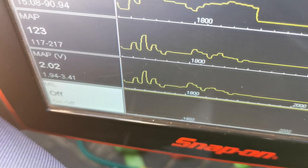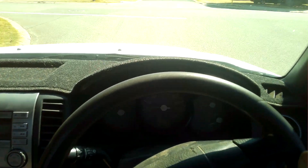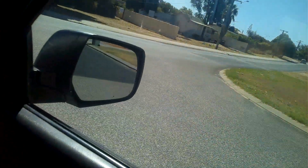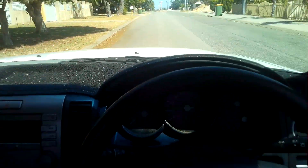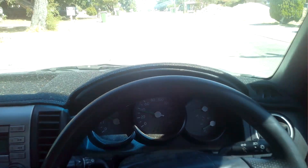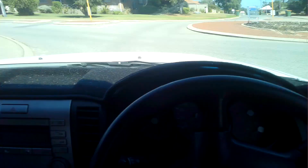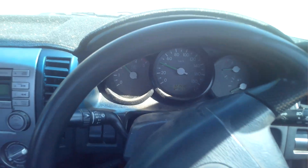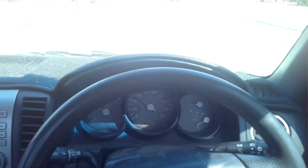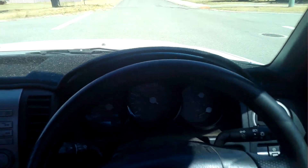Beforehand it was completely dead — we had no response and it had just maxed out on the high side. Now coming back off this road test, the new MAP sensor is installed and old performance is back. As soon as I installed the sensor I knew it was good — checking the live data, the high 5 volts it was stuck on returned back to around 2 volts instantly. On the test drive you can see it can rev above the 2500 RPM it was restricted at, that power performance is all returned, engine light is off, and I'm monitoring the live data.